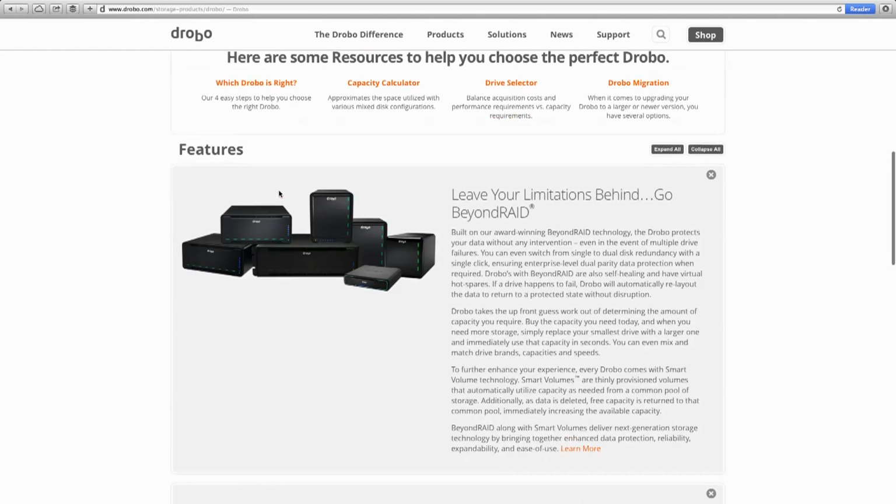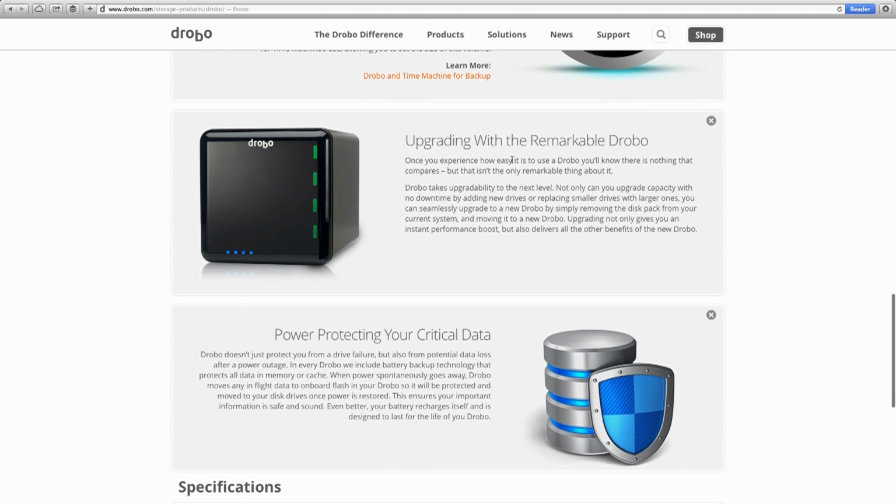So if you go here, like I say, you can take a look at the Drobo, and it's got all this different information. One of the other things that I like with these Drobo systems, which you aren't necessarily going to find in any other system, is the ability to upgrade the Drobo. What you can do, and this is very nice, especially once you start dealing with large data storage, is pull the drives out of this Drobo and then put them into a bigger Drobo. So let's say you buy this Drobo today and you're messing with it and you're like, well, it's great, but it doesn't have enough performance, or I want it to be iSCSI or whatever. Let's say you're already storing 10 terabytes of data on here and you're thinking, okay, how do I move that 10 terabytes over to something else? One of the nice things with this whole Drobo configuration is you can pull all of these drives out of this particular Drobo. Then you take them over to the new Drobo that you want to use. You plug the drives in there. It figures out everything. You wait for it to do all its replication process, and then away you go.